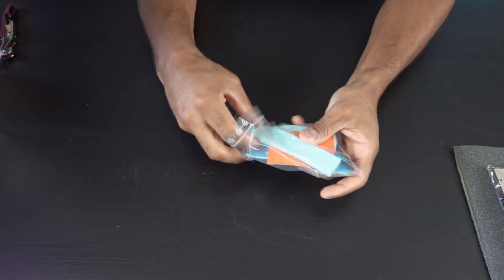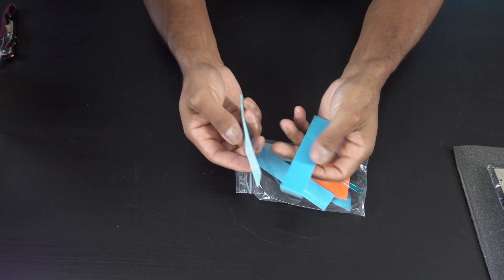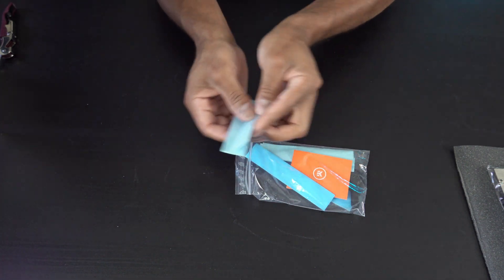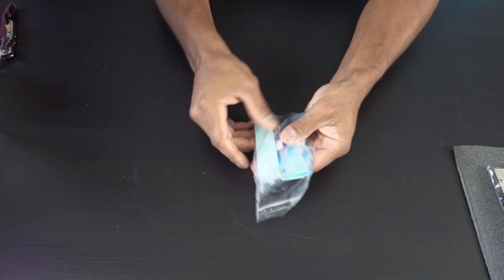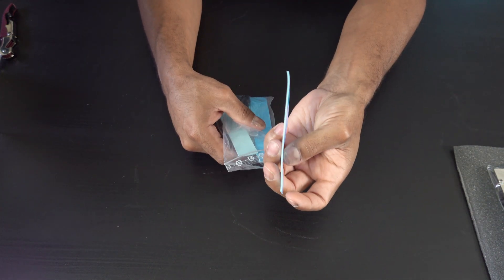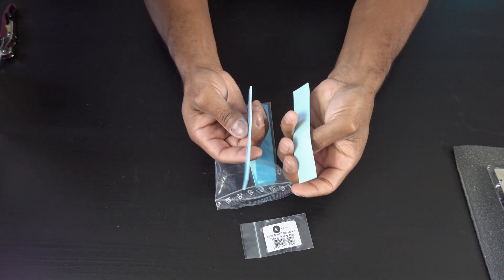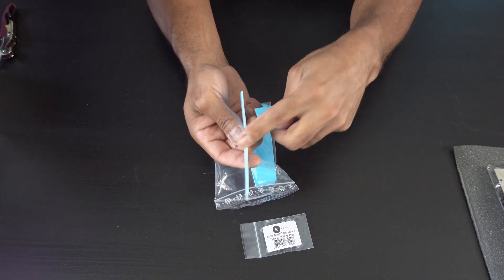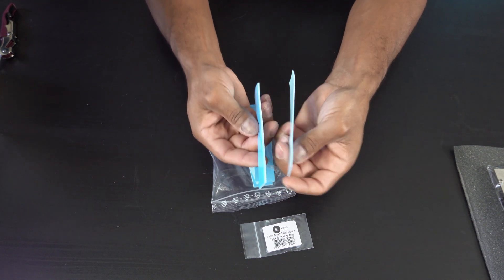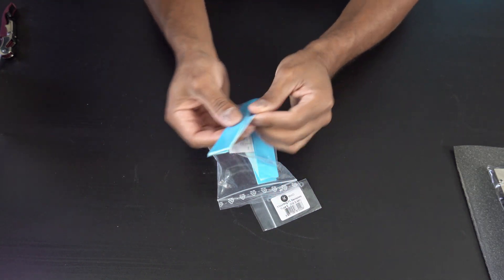I'm actually really curious about these thermal pads because thermal pads can really make or break a water cooling back plate's cooling capacity. Normally that's just passive, but these are extremely thick and heavy. Now the thickness for thermal pads is kind of an ongoing discussion. Basically, thinner pads tend to transfer heat from A to B better than a thick pad. But there are going to be parts of the back of the GPU that just won't touch the back plate — therefore you're going to need a thicker pad to bridge that gap. And a thinner pad in some areas where there's less space. So make sure you're using the correct thickness per area on the GPU.